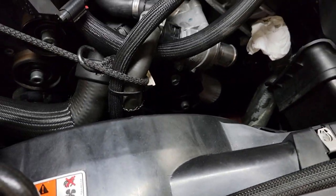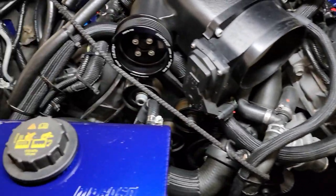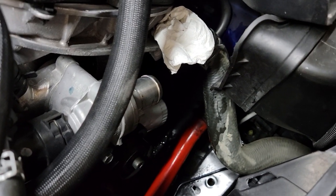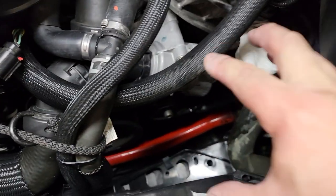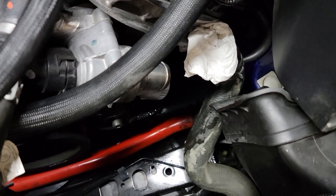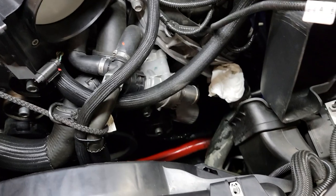And the alternator sits down in that hole. Well, I started moving things around. You have to take off the center tube and stuff like that, the belt, obviously. I kind of got that pushed out of the way so I could get it out. I had to take that hose right there off, which caused a great mess, to get the alternator out because it comes out through this hole right here. And of course, it fits pretty much in that hole. So without further ado, I'm going to try to put this back together now.